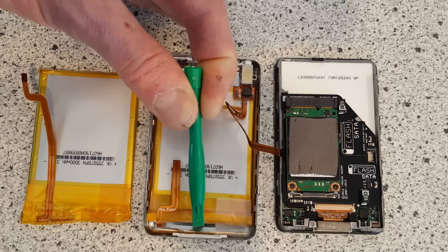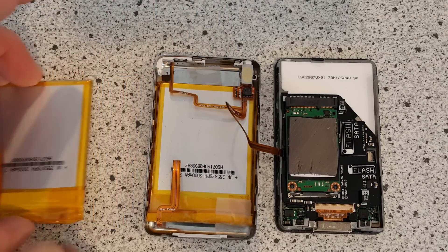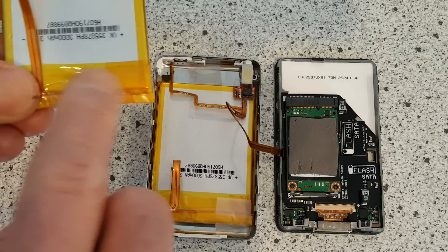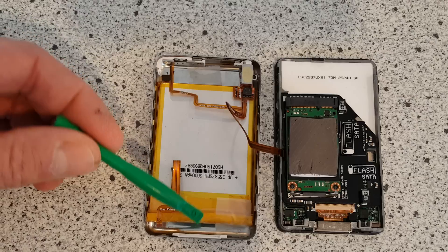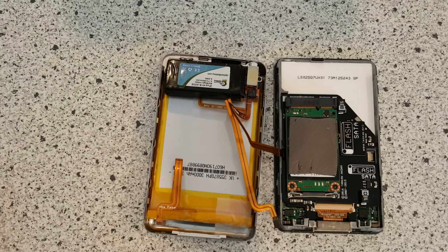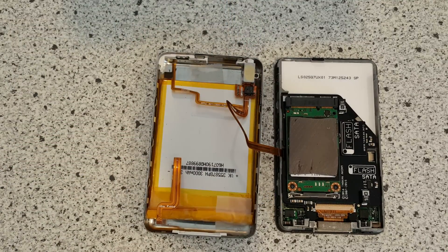I've left this area here open and free — this is for the grounding strip, so it can ground against the case of the iPod. I'll explain why that is in my next video. What you basically do is take this flap here, bend it up, and hold it in place with some tape, which creates space in this area. What's nice about this setup with the new batteries is that the old battery would sit here and take up quite a bit of physical space inside the case.